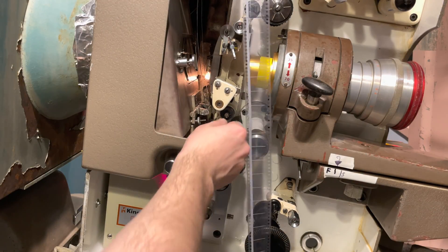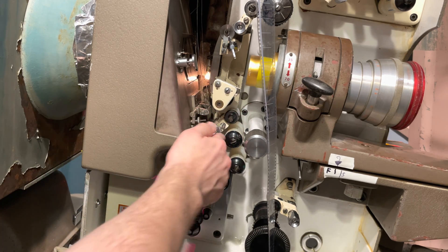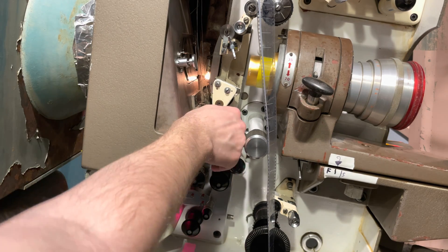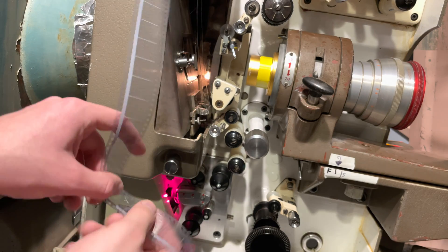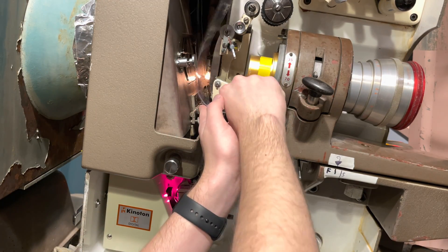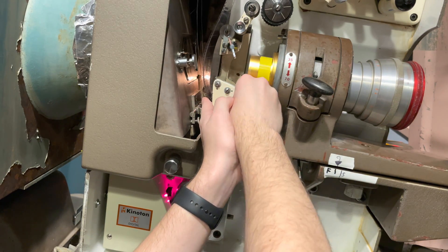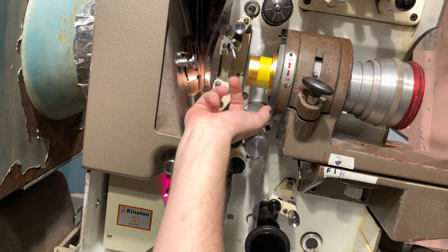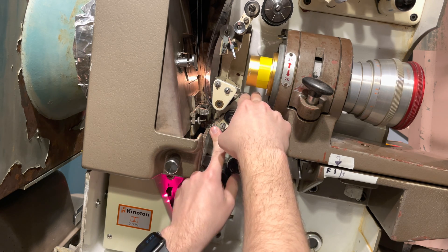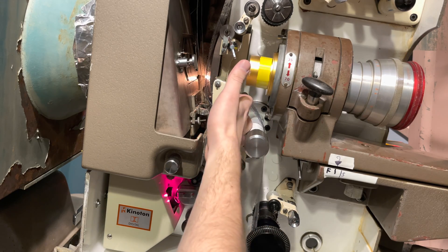What we want to do first is right here. There are these pressure holders — basically they keep pressure on the film, and there are three of them in the projector. We want it open, so make sure it's open. We want to first put the film through here. When you feel down here, you can feel that there are sprockets — you can feel the sprocket teeth — and you want the film to go into that. Once the film clears here, you can close it. After that, always check to make sure we didn't clip the film, because sometimes it'll close no matter what.